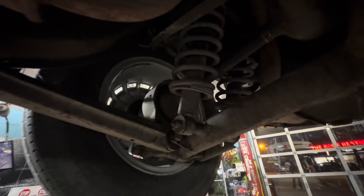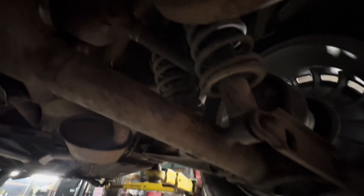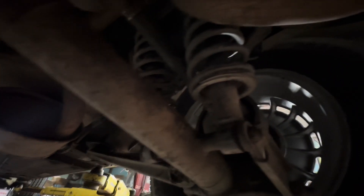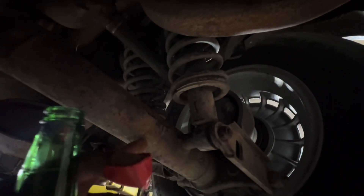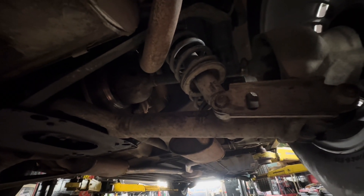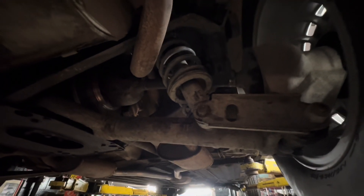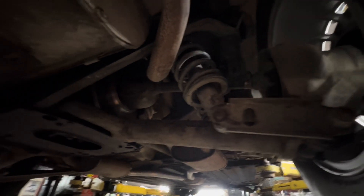This is why I had problems with the air ride — it comes with two springs on one side around the axle, so it's difficult to put the air ride in there. What I basically did was take out the spring from the back section, left the shock in there, and made a perch onto it. That was so crazy — I don't even know why I did that back in the day. The best thing to do would be to put a strut in there and call it a day.